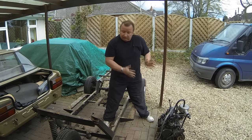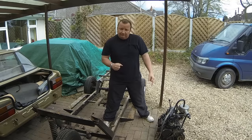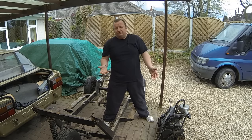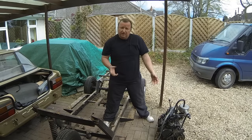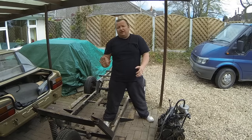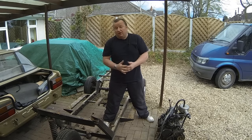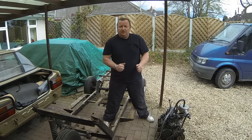As for the engine, I'm not too sure whether to go with this original engine. This was running fine perfectly, but it was just smoking a lot. I understand they do smoke, but to get through an MOT there might be a reason — it might be the valve guides or oil seals that have gone. I also noticed that when we went to take our foot off the clutch, it was very grabby and it pulled very sharply. So it may need a new clutch, which is not a large expense, but I'm not sure whether to put this engine back in or go for the 850 engine, which I think I've got one in the log cabin.